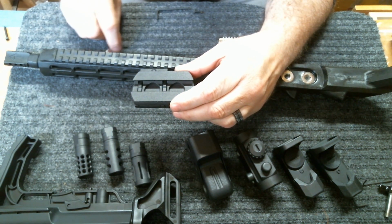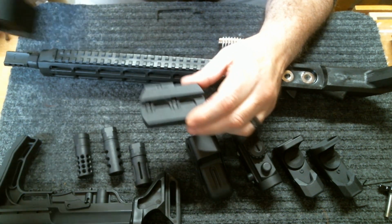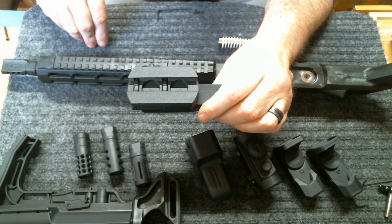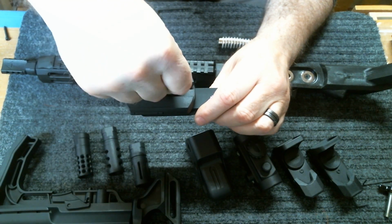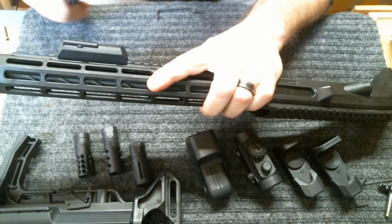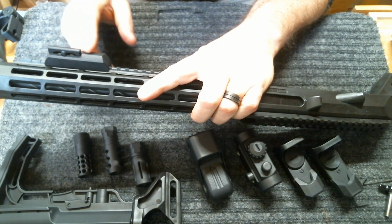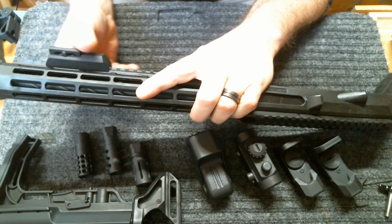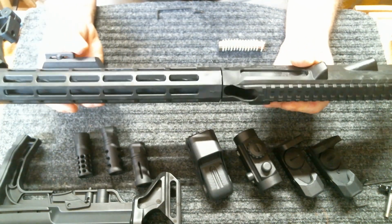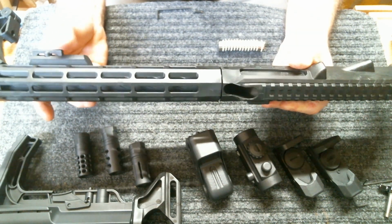So in order to get these back in here, the best way to do it is to take your controller connector, lock it in place, then set the magnets back in there, and they go home. Then you can slide that back on there, and they're locked in place. So just keep in mind, if you've got to put magnets back in, use your controller connector to hold them. It's going to orient them in the correct position, plus it'll hold them in place while you put this back on. That shouldn't come off. You should feel it when you get there. It's just in case something does happen.